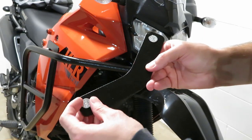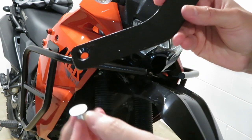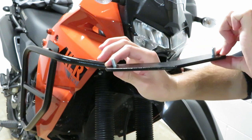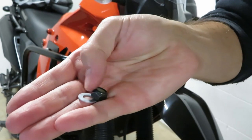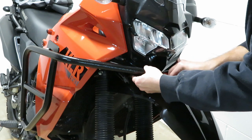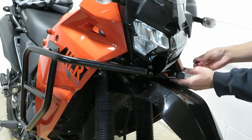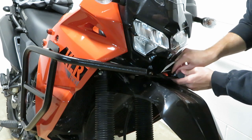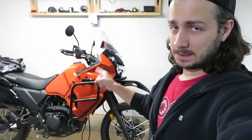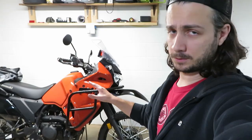So here we've got the boomerang bracket. This is going to be directional because you've got the countersunk holes for the matching conical fasteners. Those get installed this direction, and this is actually going to be installed upside down with the point pointed forward. Get the black nyloc nut and washer ready to go, put this through the hole, put a washer on, and a nyloc nut. Do the same over here. As long as everything is left loose, this lines up absolutely no problem. I'm going to hit each one of those bolts a little bit at a time until everything kind of falls into place, taking it easy so I don't snap anything off or strip anything out.